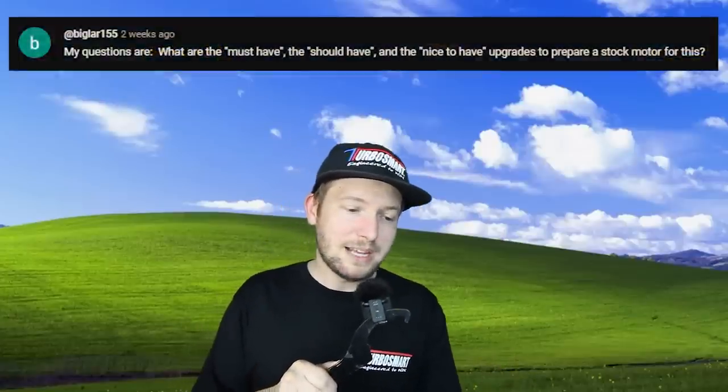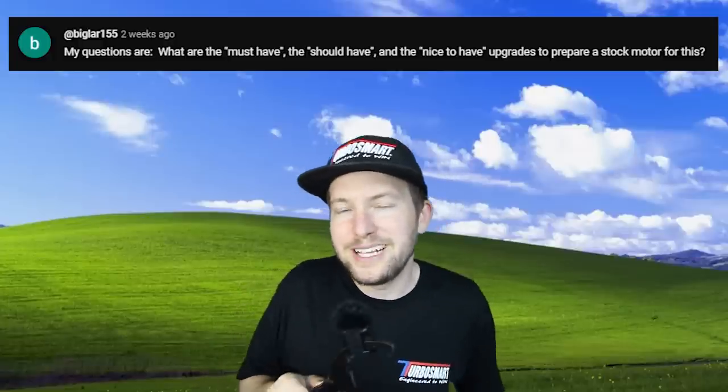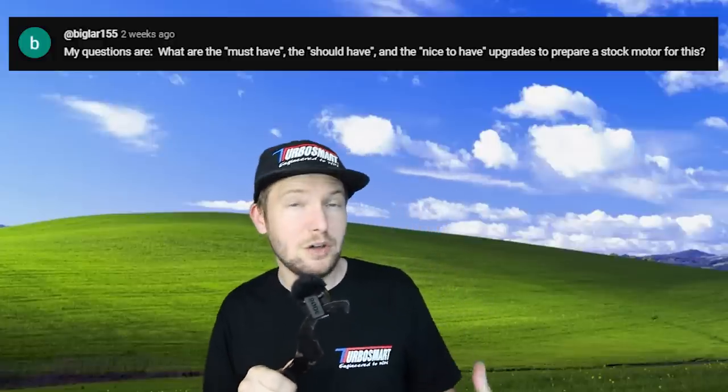All right, this is gonna be the last question, but definitely one of the most important. Big Lair 155 from YouTube asks, essentially, what are the things that you need to have to install this kit, and what are the things that you should have to install this kit? So as far as what you need to just go supercharged, really all you need is the kit itself, a way to manage fuel, and a way to lower your timing.